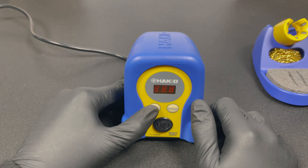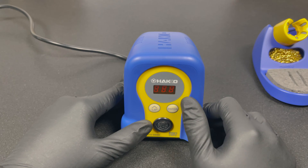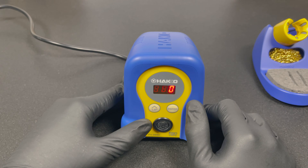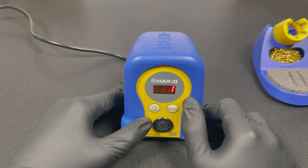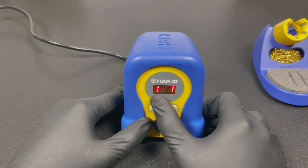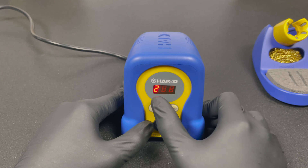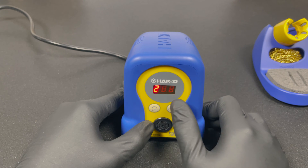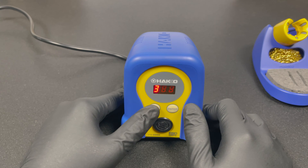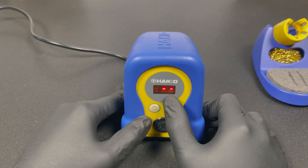The final setting 14 is the password lock mode. When you enter, you have the choice between option 0, option 1, or option 2. Option 0 means no password. Option 1 means a partial lock — when you enter it you go through three password locations. The first location is for temperature settings, and the second number indicates whether the password is on or off. Confirm your choice and you go to the second location: the preset selection mode, either 1 or 0.